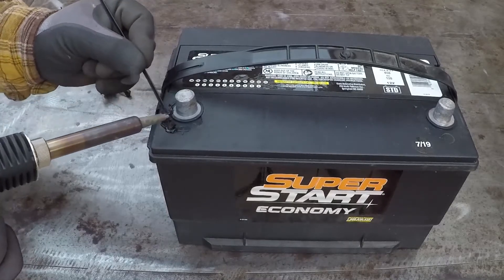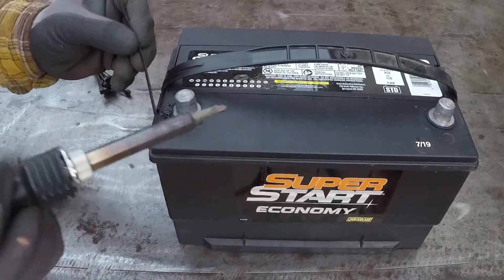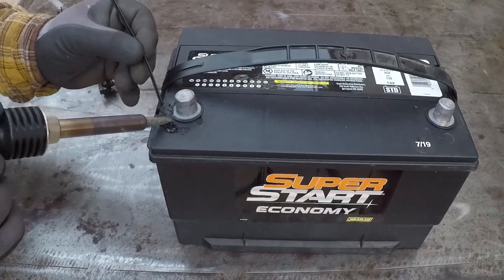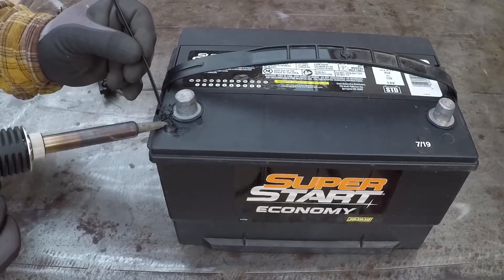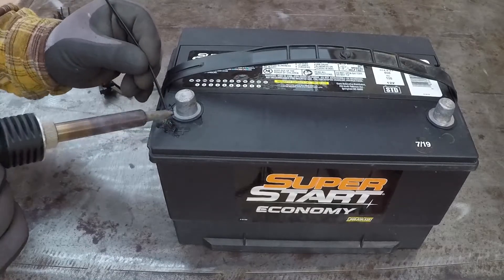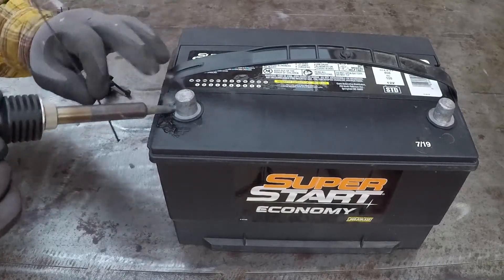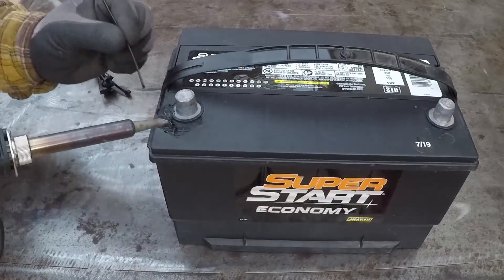The ABS is good for plastic. It's flexible and strong, and it will make excellent welding material. I use this technique before to repair many things on cars and other stuff that's made of plastic. You could also sand this after you finish it and prime it and paint it.